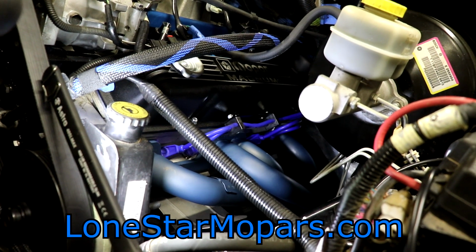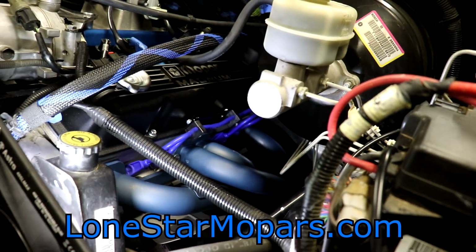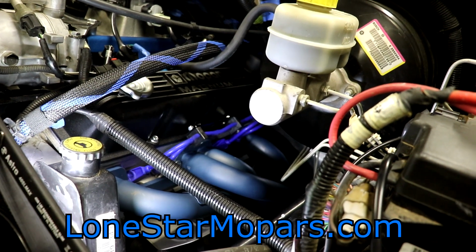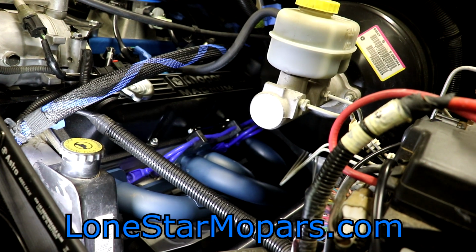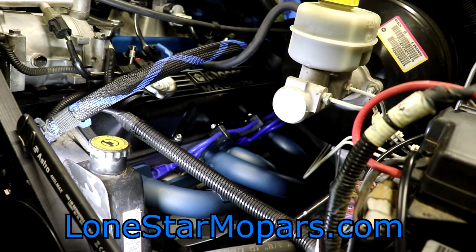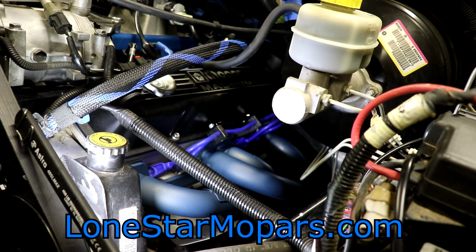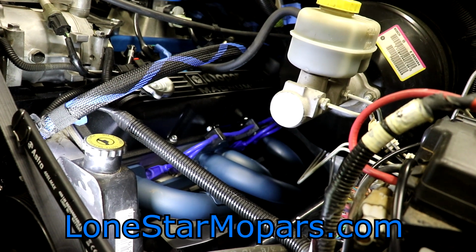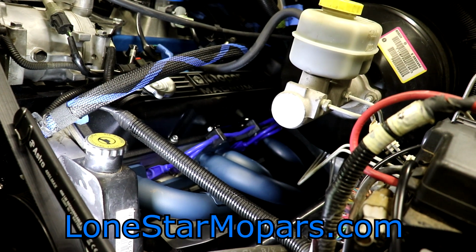Those are just sort of bad as well, in part because with the brake booster and the steering shaft and everything else that you don't have on the passenger side, you just don't have space to get to it with the torque wrench. The way I hit those is on the bottom with the Tekton angle head and a Stubby. That's really about the best way I can do it. You basically, whatever bolt you can get to the easiest that you know is torqued properly, put a wrench on it, whatever wrench you will be able to access the remaining bolts with, see what it feels like, and just get there. If it takes you so much effort you can't turn it, on one that's torqued to 24, get down there and get it to that same point.